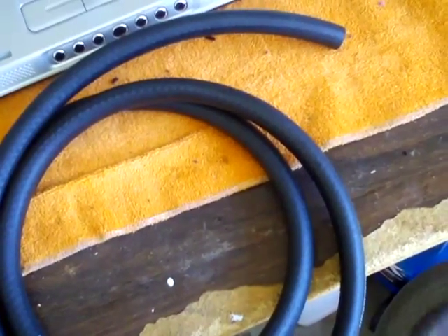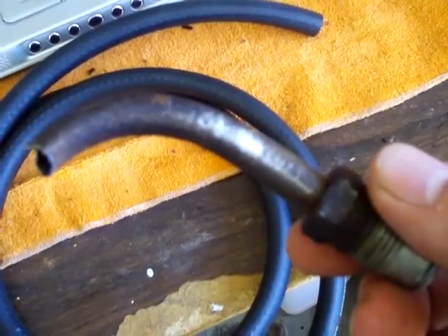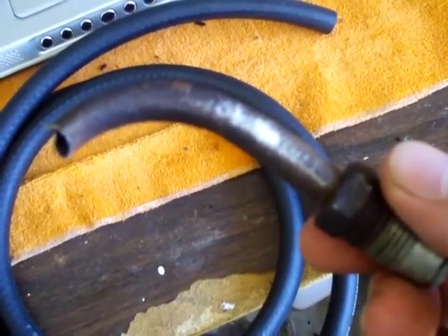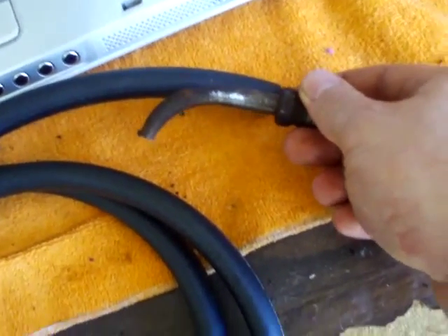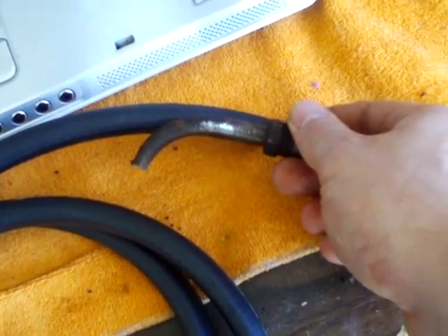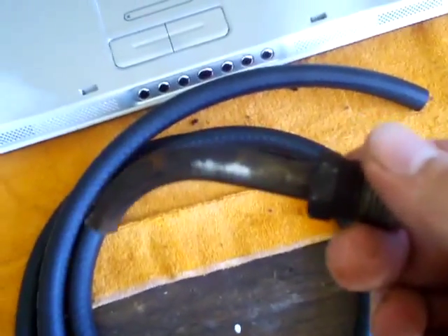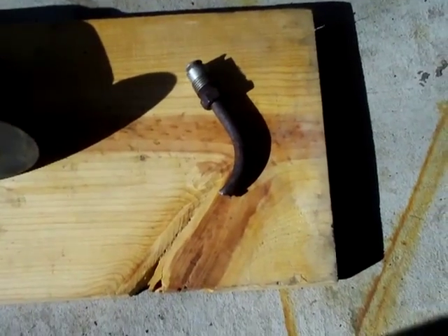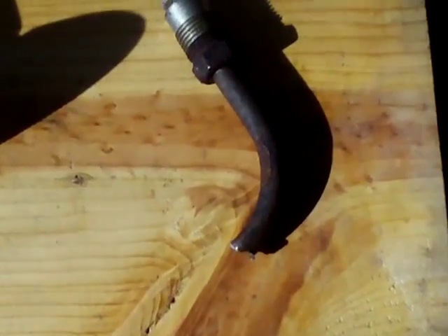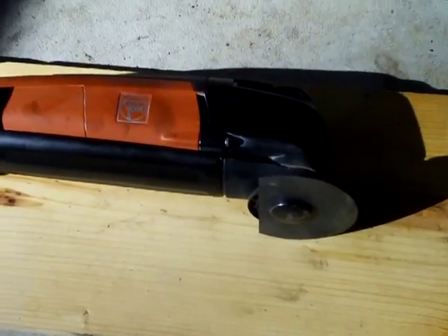The part they gave me didn't work, and I broke off the end of the line coming from the radiator going to the trans cooler. So we're just going to use a pipe cutter and cut it off right here, then put that in the hose and use some sealer when we put it on. Actually, I decided not to use a pipe cutter because I want to save as much of that pipe as possible so it'll slip on further — we're going to use this little cut-off tool instead.